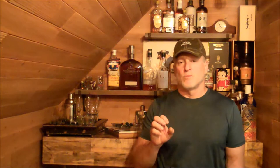Let's briefly talk about what's happening here. When you buy a new set of tires, especially if they're not your original equipment tires, they are going to be under a different set of conditions than the car was set up for at the automotive manufacturer's location. Oversized tires on an oversized wheel are going to have a different load characteristic, therefore different compression on the tire and therefore creating a different radius. Air pressure and wheel width are also factors, and it could be off quite significantly. On mine it was off up to 20 revolutions per mile, which definitely will impact your odometer and speedometer.